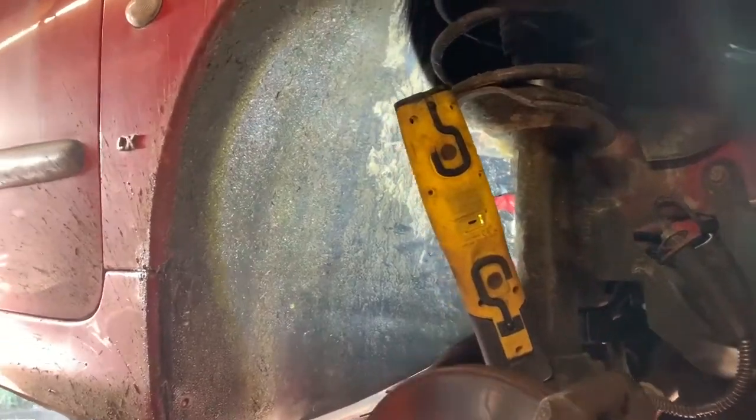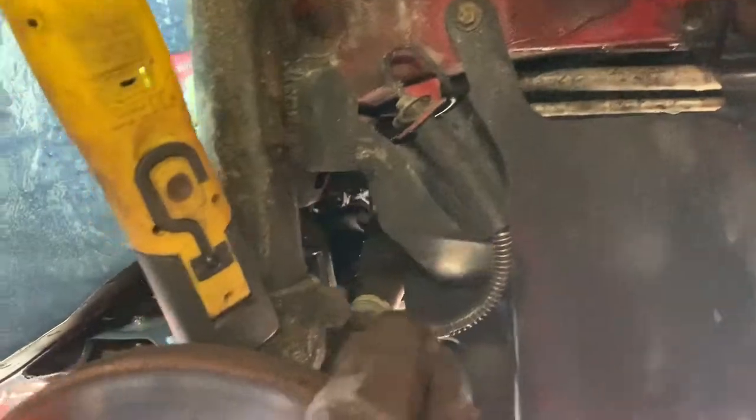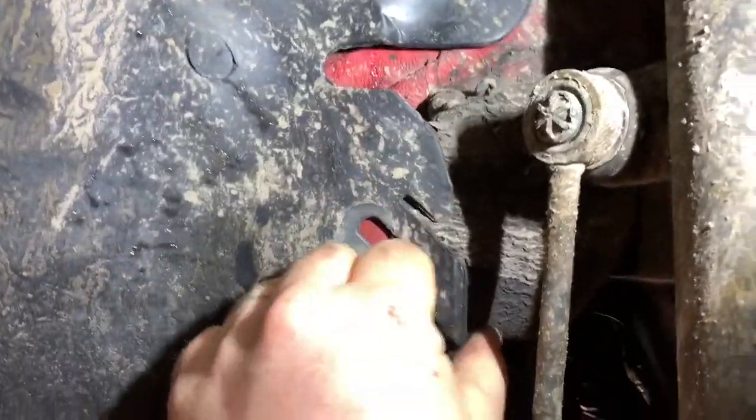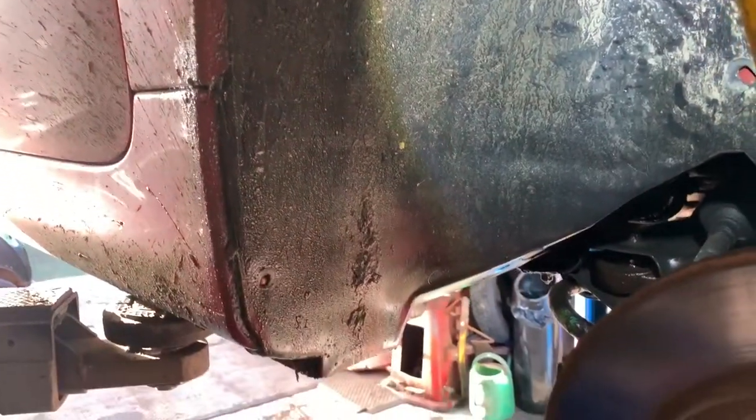So hopefully this should just pull out now. Now whether I'm going to be able to do it with one hand, who knows. Oh well, okay. So there's first lesson learnt. I think you only need to take the front half out and not the back half. Cool. Okay then, so now there's this other little shield, which, oh, looks like you might have to take a bit of the back half out. No you don't. You don't have to take that back part of the wheel arch liner out at all. So if you're watching this and doing the job at the same time, put them bits back.